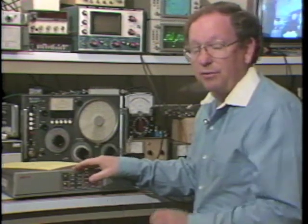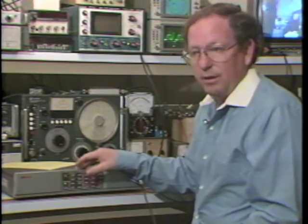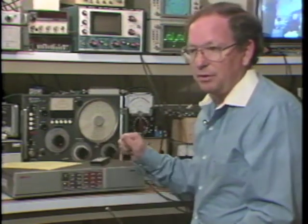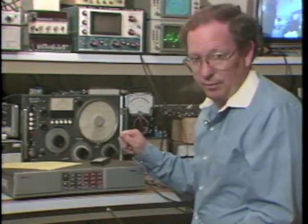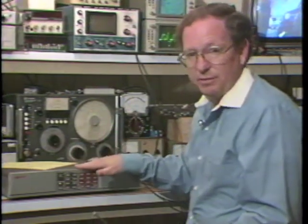And the last little detail, and we'll get out of here, is that once you're in the scrambled mode watching this, the remote control on your satellite receiver, as far as audio is concerned, doesn't work. The audio system comes through the VC2. So you might find if you're used to being able to mute the audio and what have you, you can't do that anymore. So clearly, once you're in the VC2 mode, the VC2 commands and runs.